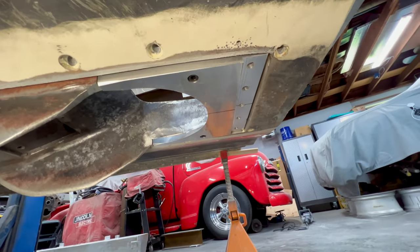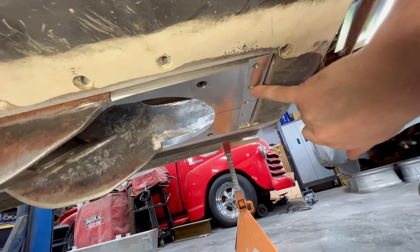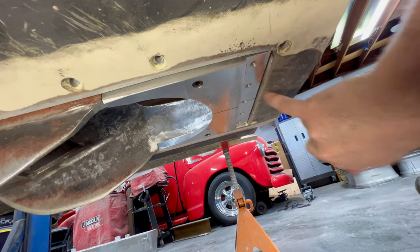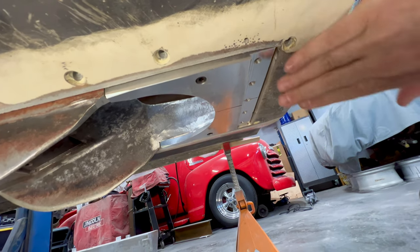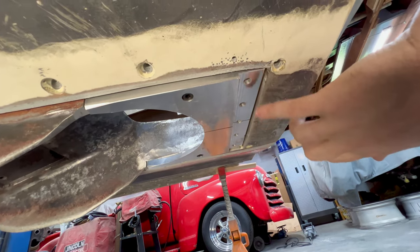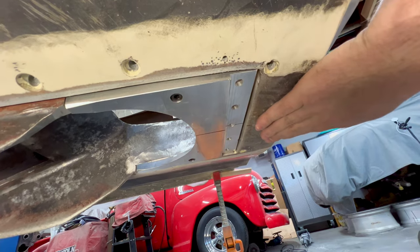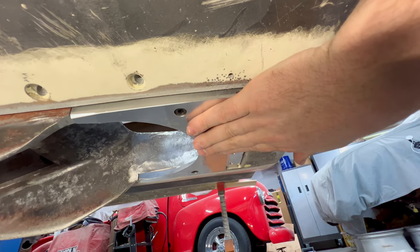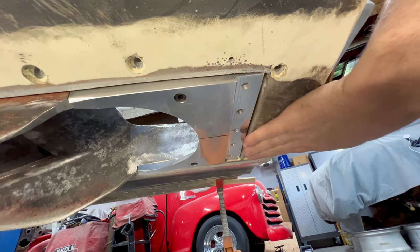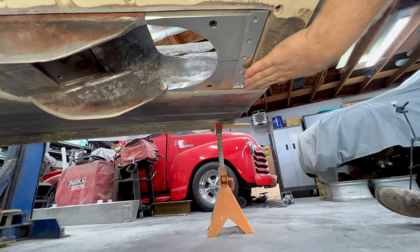Now that the intake is set in place, let's get underneath the boat. You can see right here where the existing keel sits, and where the ride plate sits onto the shoe — that surface is above the keel. We can't get that ride plate bolted on because the keel is going to be interfering, so we need to grind all this down so it's at the same level or just a hair higher than the surface on the shoe, which will allow that ride plate to come out without interfering. This is why I put the shoe on with zero shims — I want it as high as possible so I know how far to grind. I need to pop this intake back out, grab some tools, and start knocking some material off.